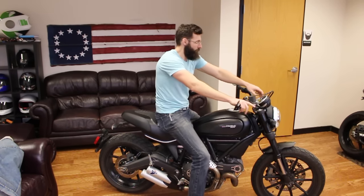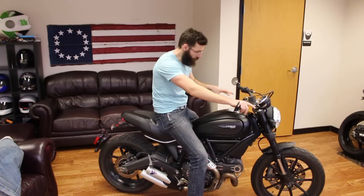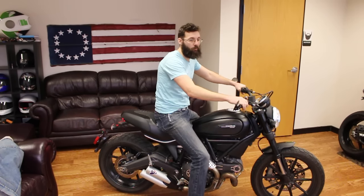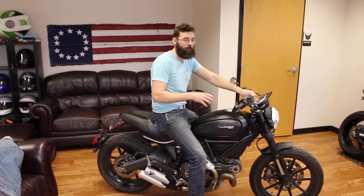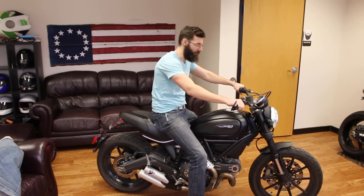Option number two: you turn the key on, the light comes on, the gauges come on, the fuel pump cycles on. The bike is somewhat responsive, but when you go and press the start button, it cranks really, really slow — rawr, rawr, rawr — and then goes tick, tick, tick. Your battery is dead. It has enough volts to turn the accessories on, not enough to crank the bike. You either need to charge it up or replace it. You probably left your key on or something. That's the second most common scenario.